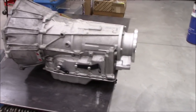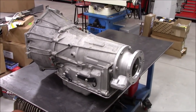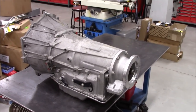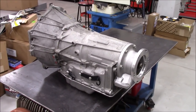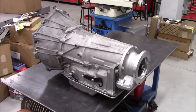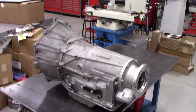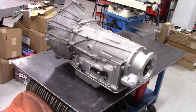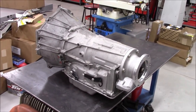Coming around here is the real unsung hero of these GM packages: the 6L80 transmission. This will make things perform beautifully on and off-road. There are so many features beyond just having six gears. It has a lower first gear and a higher overdrive than the 42RLE that's in my Jeep now. The 42RLE has a 2.8 first gear and a 0.69 overdrive.